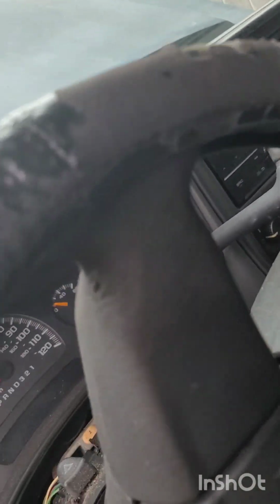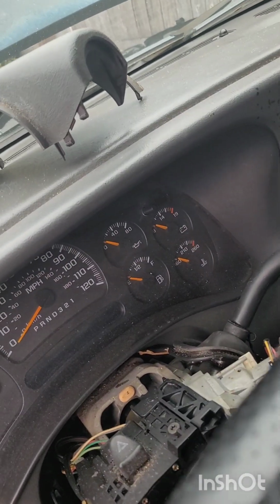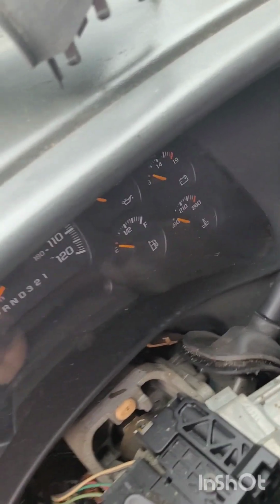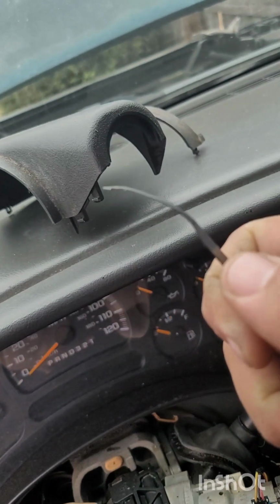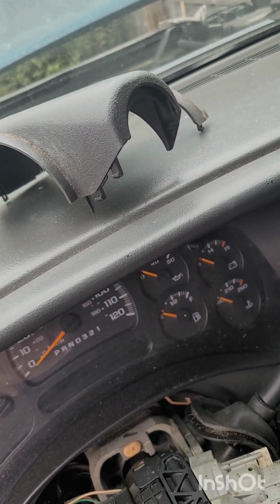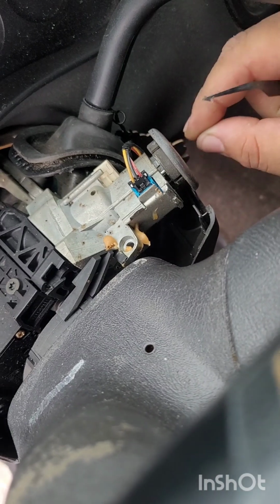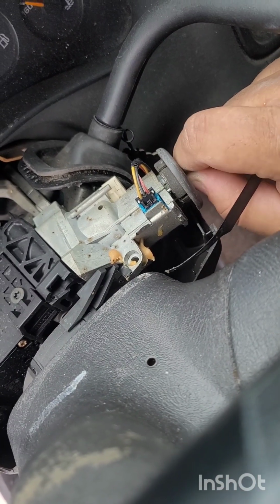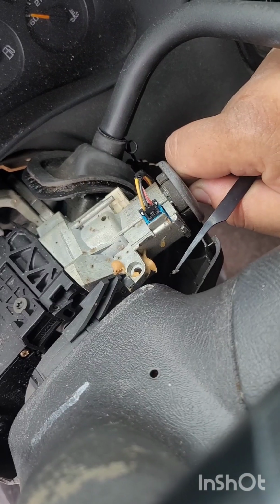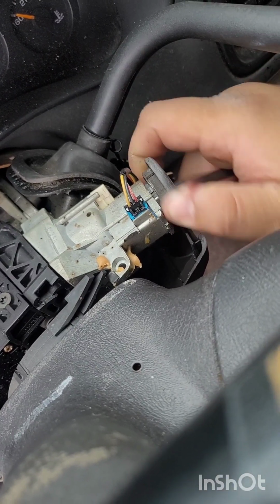First thing you're going to do is, on these cylinders, there's this detent bar, and you want to depress it to where it pushes in the pins so it can move freely. The sidebar that's on here, all you're doing is putting the pick inside this. You're going to take this pick, stick it inside the sidebar right here that sits on the side of the cylinder, and all you're doing is turning it slightly so that when you put your key in, the jiggler key, you're going to actually run it in and out, raking it and slowly turning as you're raking. And all it's doing is pushing that sidebar forward slightly so it can cause the cylinder to turn.